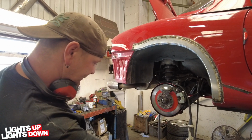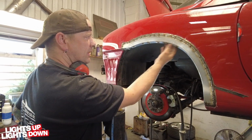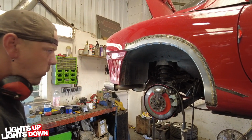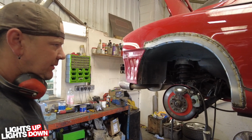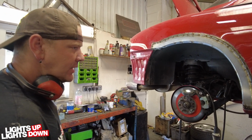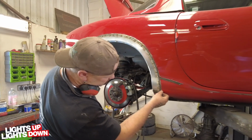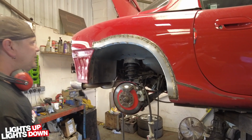And then, as you can see, welded on outer skinning. I'm just grinding it back now. When we've done a seal before and we know that it's good, we come down and meet it, or in some cases you've gone slightly past on this one. This is where the original weld line was for the old panel, so I've gone just slightly below it, and then finish the rest of it off.